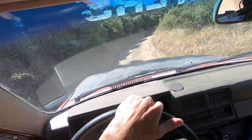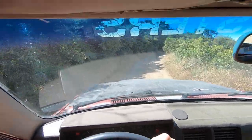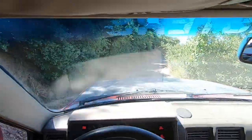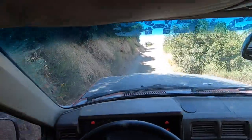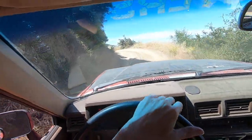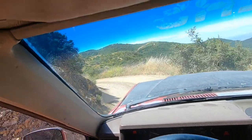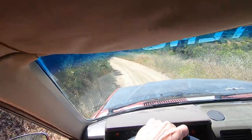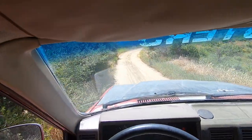Let the truck, let the suspension do the work. You're just guiding it along. It's that heavy steering — it just wants to go straight, so if you let go of the wheel it just wants to go back straight. That's because the front end is welded. It doesn't have a differential posi-traction type setup, so it's very heavy.